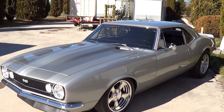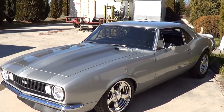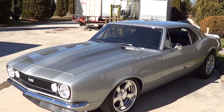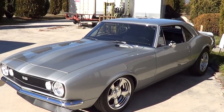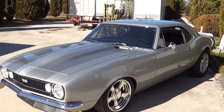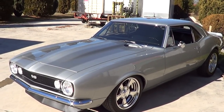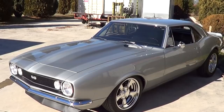He wanted it done right, but he didn't want it to be everything chromed and tricked out. I say, we used brushed stainless fuel lines and brake lines and everything underneath. HPC coated exhaust, all the floors are done smooth and slick underneath in satin black, and we had it on a rotisserie and did that and everything underneath it, and then put the front clip back under it.